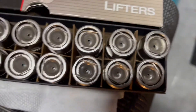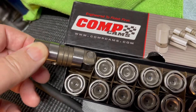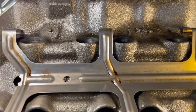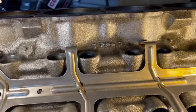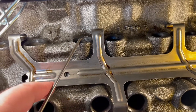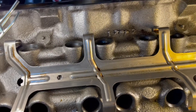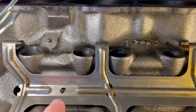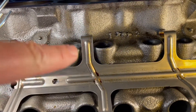These are shorter than the standard roller lifters so they don't pop out of the bore. According to the instructions, you lay the tray in the valley. You're supposed to put your lifters in place and dog bones on there — just for a few of them, you don't need to do it for all of them.